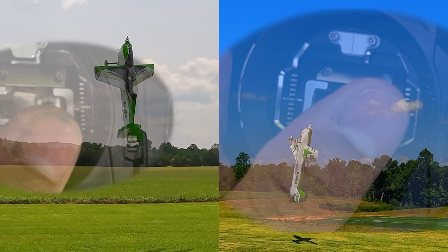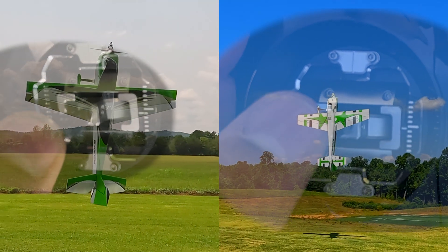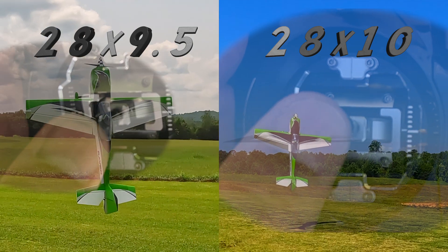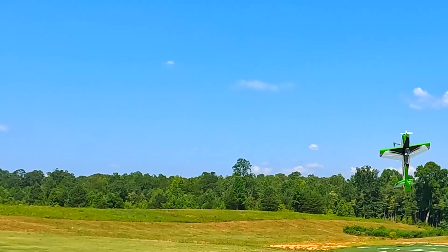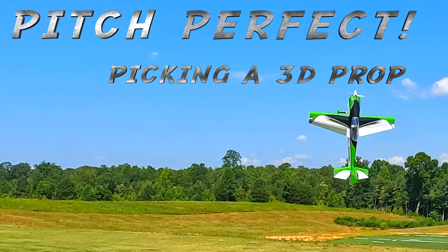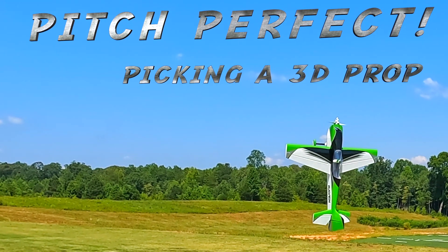When you look at it, one of them has a higher RPM than the other one does, and one of them is very stiff where the other one is very fluid. I put a different engine in one of my planes, so now I've got to find which prop is going to work best and where my CG needs to be.